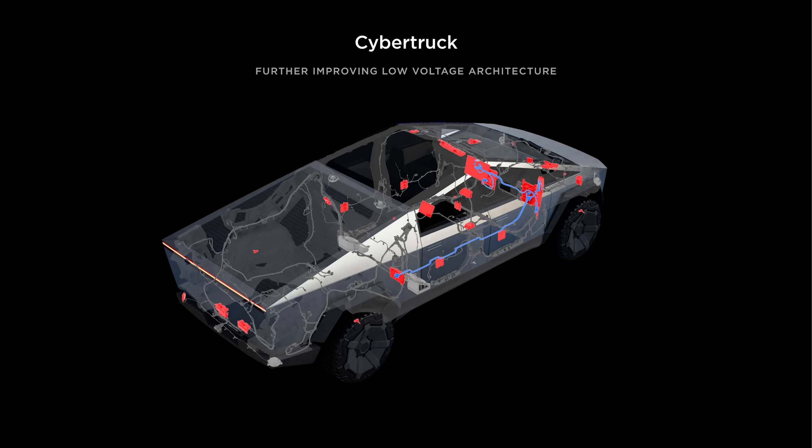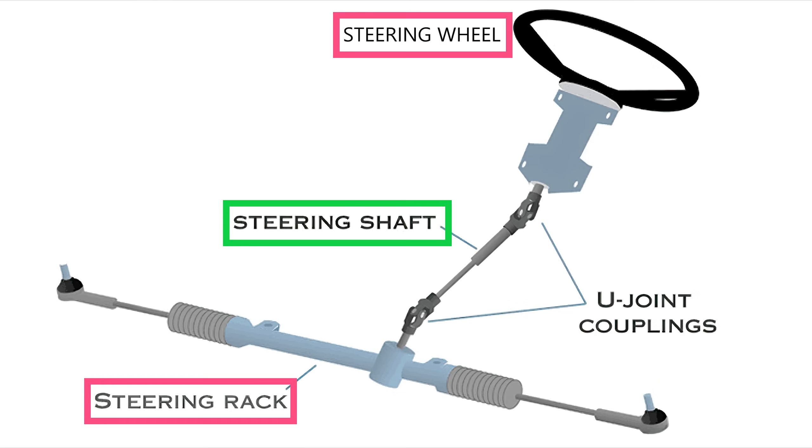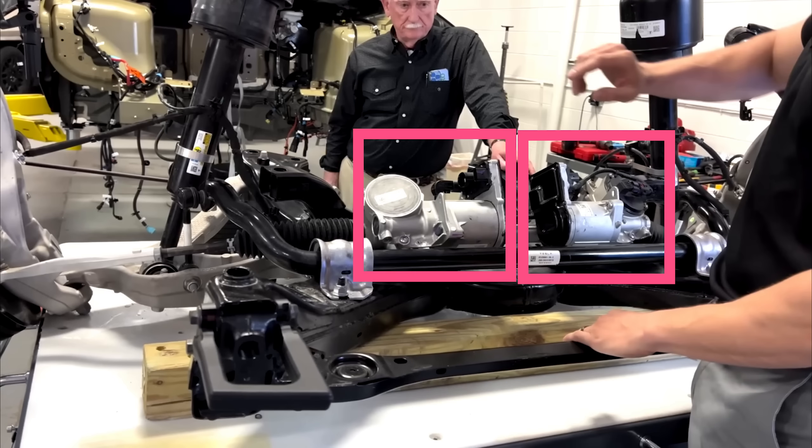The next innovation to discuss is Tesla's new 48-volt architecture. Although Tesla probably could have done the unboxed process without a 48-volt architecture, it certainly makes it easier. Tesla switched from a 12-volt to a 48-volt wiring architecture in the Cybertruck because high voltage reduces the amps that need to be pushed through the electronics, motors, and wiring system. That, in turn, means smaller electronics, motors, and wires. That's especially helpful for a steer-by-wire system because without the redundancy of a steering shaft — which is needed if the power steering goes out — steer-by-wire needs an extra steering motor or actuator for redundancy and safety. So with a 48-volt system, Tesla was able to make the two-motor steering rack assembly more compact and with thinner wiring.